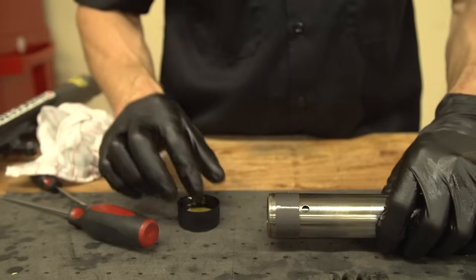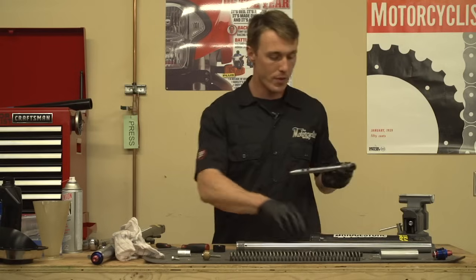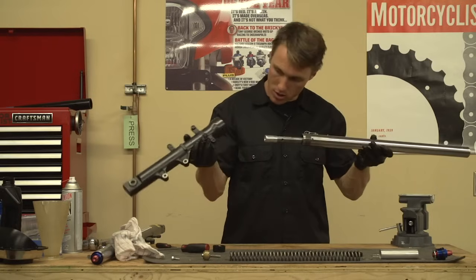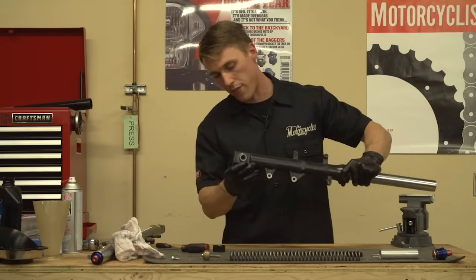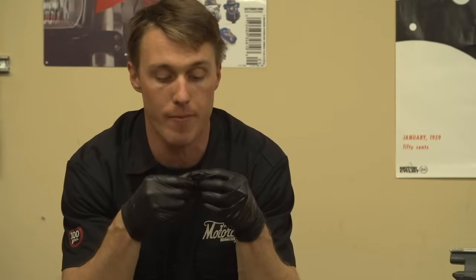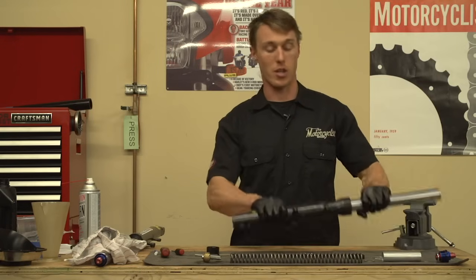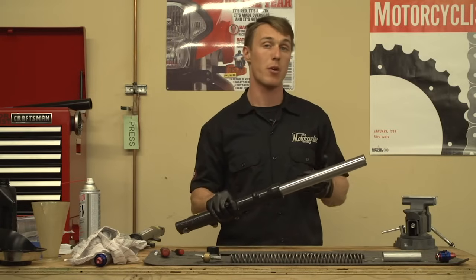Throughout assembly, we'll be lubricating all of the friction components with clean fork oil. Lubricate the fork stanchion bushing liberally. Next, we're going to take the damper rod, slide it into the stanchion, and then take the bottom out cone and place it over the end. Now take your fork lower and slide it on and press it firmly against the end. Then take your damper rod bolt with nice clean threads, install a fresh copper crush washer from your kit, put a very small amount of blue thread lock on the threads, and screw this into the bottom of the fork into the damper rod. With the damper rod bolt installed, the two parts of the fork are now connected. We haven't torqued the bolt yet because we still need to put in the spring, spacer, and fork cap to apply some pressure to the damper rod so it doesn't spin.